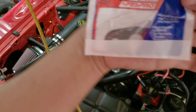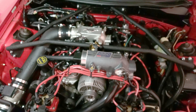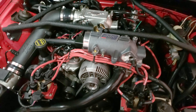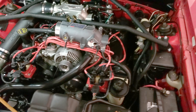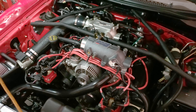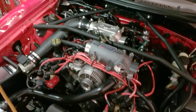I'm just going to get the EGR gasket changed — I'm not going to change the one underneath because it's practically brand new. If yours is cracked, go ahead and remove it, but mine is still good. I haven't really put any miles on this engine, it still needs a tune, but before I get the tune I'm doing everything I can so we can tune everything all together. Before messing with anything, I'm going to remove the battery cable so the car is completely unplugged.